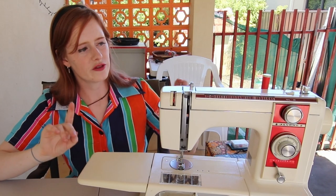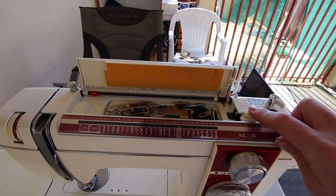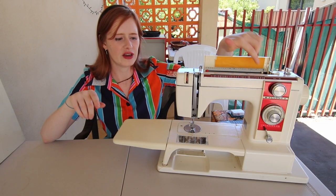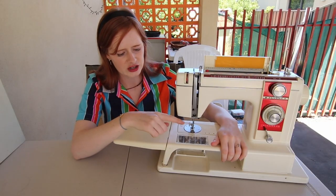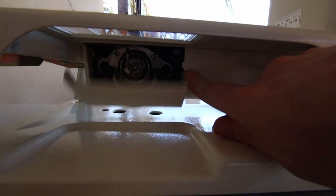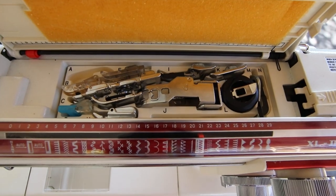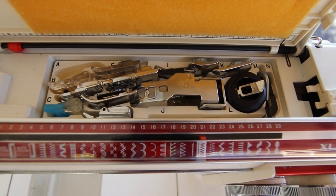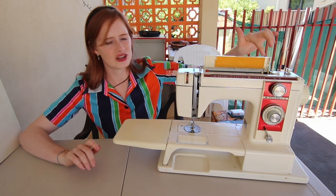This machine is quite unique. One of my favourite features is that it stores all of its feet in a top compartment, which I've never seen before — a genius idea we should use on a lot more machines. Talking of the bobbin, this machine actually has a see-through plate so you can see into the bobbin when you're changing it. It has a front-loading bobbin, similar to the design that Janome uses today. All the feet are kept in unique shaped slots so they don't roll around, and inside the lid there's actually a list of all the different stitches with what tension, what dial setting, and what foot to use. I've never seen this on a machine before — if I ever design a sewing machine, this feature is definitely going in.